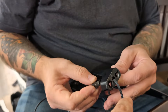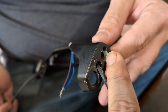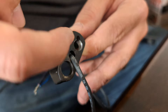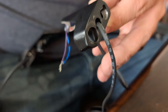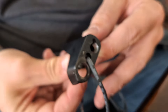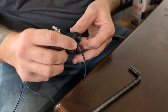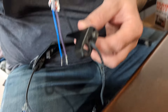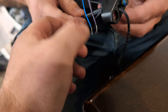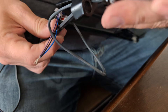All right guys, so I'm back. This is what we had to do — you had to drill out a 5/16ths hole to make the new bolt fit through. We had to countersink it because the head of the bolt was hitting the top of this piece on the inside. That's pretty clean on both sides. It'll be covered up — we'll never see this again. But this is what you've got to do to make this fit right. We're going to add a dab of Loctite — a little dab will do you. Make sure you run the wires through before you do this.